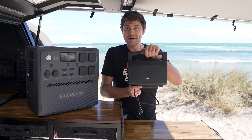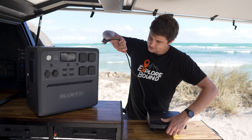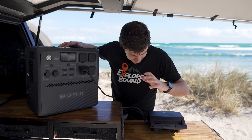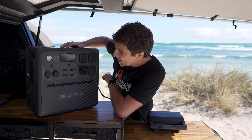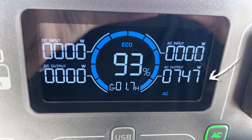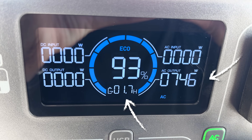Here's a camping favourite — the Kmart Twin Toasted Sandwich Maker. Plug that into the inverter using a different slot. Turn the inverter on, and it fires up straight away. We're using about 750 watts, and at that rate we'll be making toasted sandwiches for 1.7 hours.